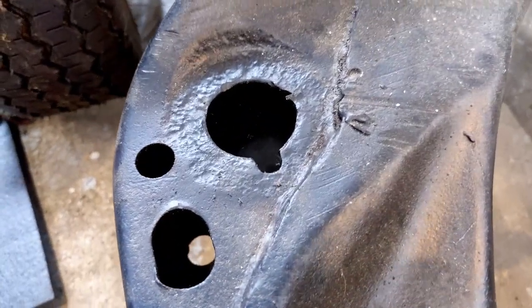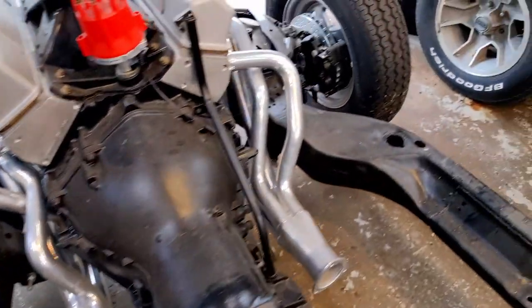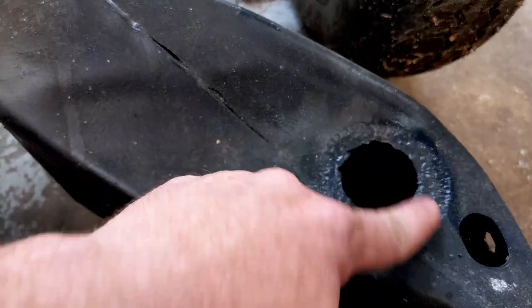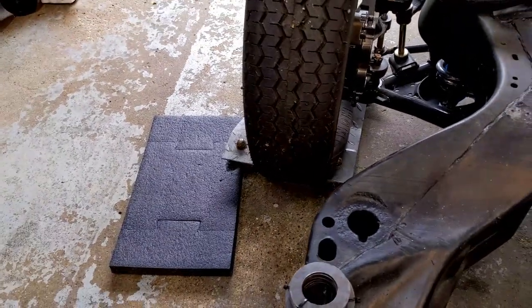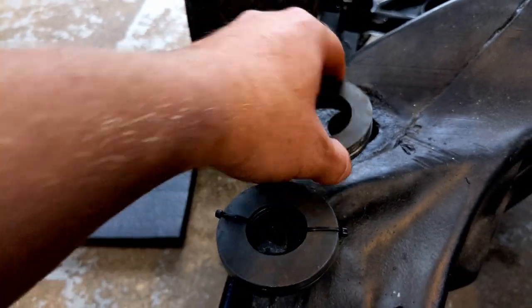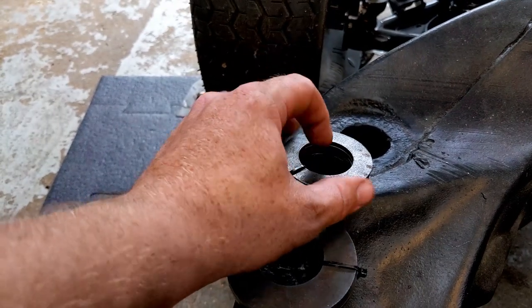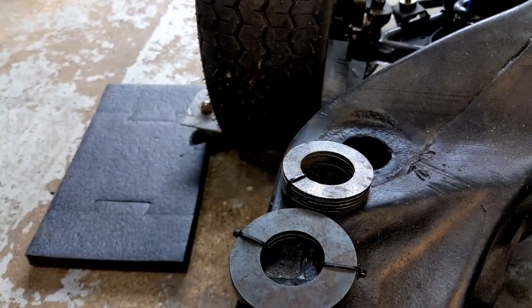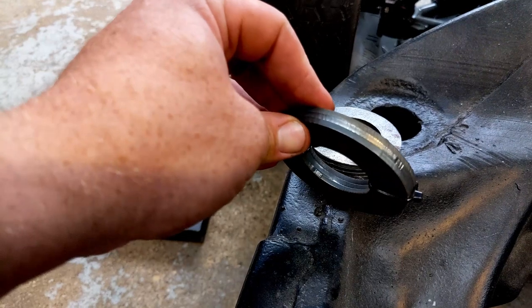We can see — maybe better like this — all that dimpling where rust was forming. This is the better of the two sides. My car is the same way. This one is much worse; you can see it was starting to eat here and getting thin, so I want to cut this out and replace it. What I did is I called my buddy Jeff over at First Try Engineering — I'll try to put a link below for his shop. I had him cut me out these essentially washers. I had him do the ID the same, but the OD different. These are one-and-a-half inch center, and I want to say these are three-inch and these are two-inch. He cut me out a few of each and sent them over in a few days, which was awesome.